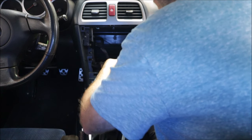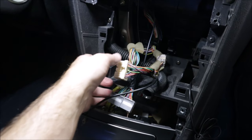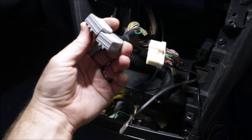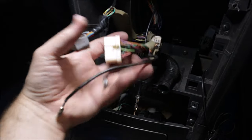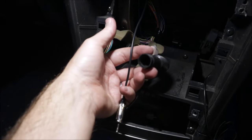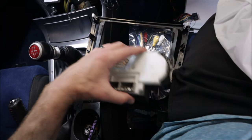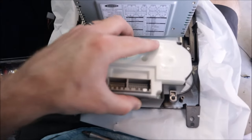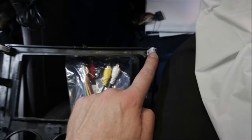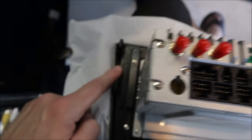Remove the antenna and everything on the back of the head unit so you can get it out of the way — or maybe throw it in the trash. With the head unit removed and the jumper harness unplugged and all the aftermarket stuff removed, your factory harness should look like this: two main plugs, an additional white plug, a ground, your antenna, and the HVAC tube. That's starting from stage zero. The heating and air conditioning control head will transfer right over to the iDoing unit with four screws. Also transfer over the two white clips onto the iDoing unit so you don't get rattles and the unit stays nice and secure.